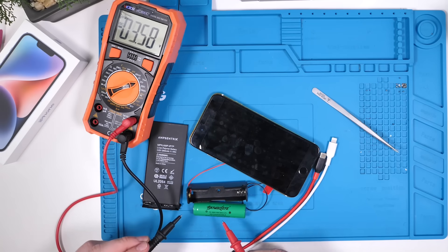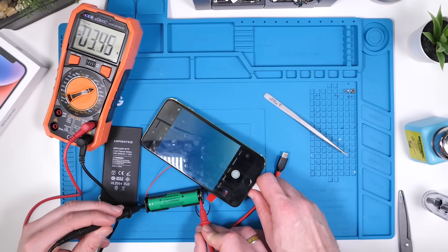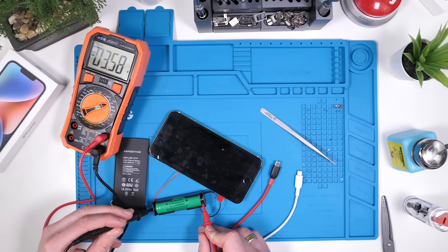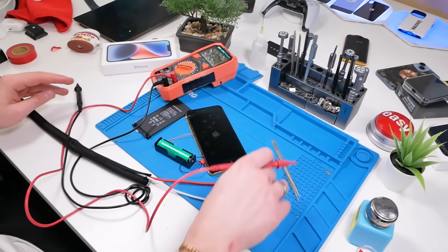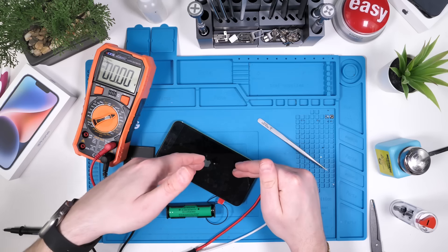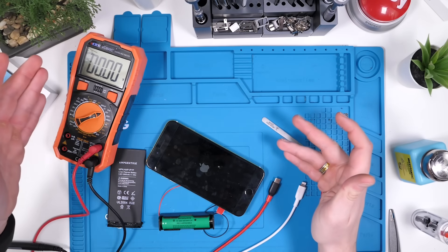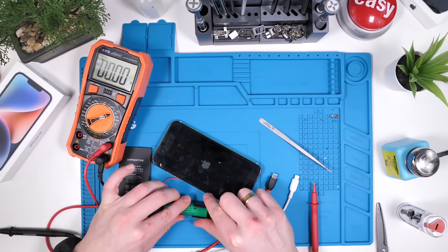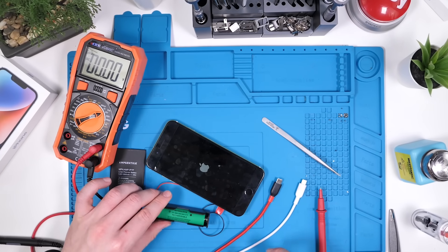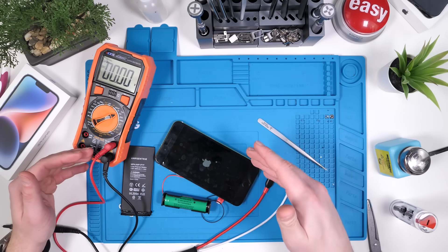I think I found the problem. If I open up the phone and go to a demanding app like the camera, and then unplug the charger, you can see that it's dropped to 3.6, 3.5, and the phone has shut off. Basically the phone has a failsafe, and if the battery isn't providing enough power to the BMS, then the BMS tells the board to shut off. Because this is only 3.7 volts and 3,000 milliamp hours, adding more batteries might create a more stable voltage baseline, which in turn would keep the phone on.